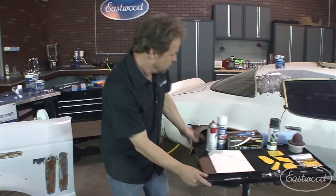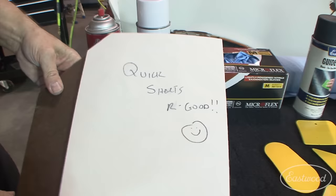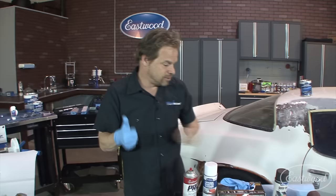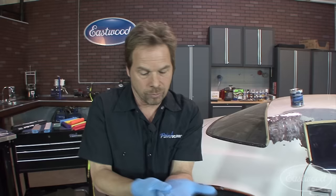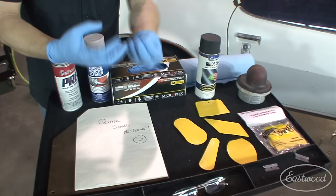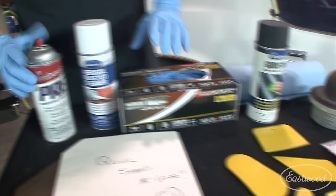Let's talk about some necessities. Quick sheets are good — they give you a clean slate. I'm not walking around looking for chunks of cardboard; I just peel the sheet off when I'm done. I'm wearing gloves because I don't want to wear the filler off my fingers, and it will wick the moisture out of your hands and crack, especially in the summertime. We've got some spreaders — there's five different spreaders in a pack with different shapes. Depending on the contour and shape of the piece you're filling, you can use different ones. If you've got a tight area, you can score it, break it, and create the type of filler applicator you want.